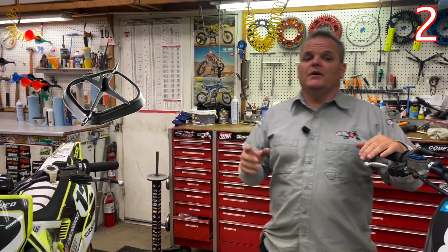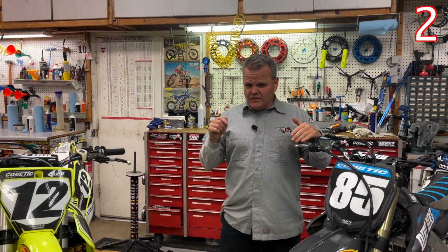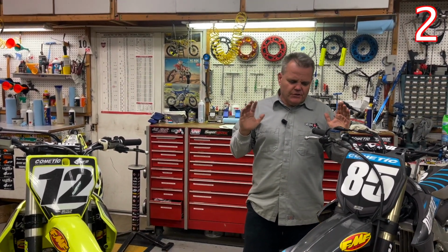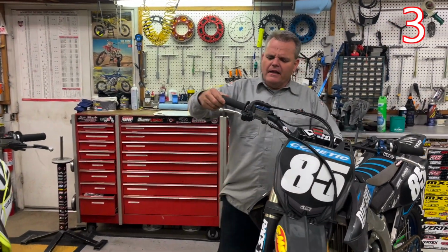Okay, so one of the first and easiest modifications to your bike is a two-stroke air filter cage. You simply remove the cage that has a backfire screen and put in a two-stroke cage, or a special cage that's designed to not run the backfire screen. That's a quick way to get a little more snap out of your bike for little to no cost. Cheap.